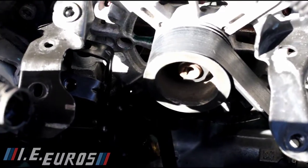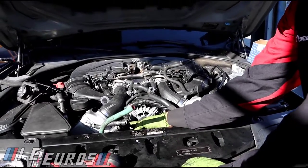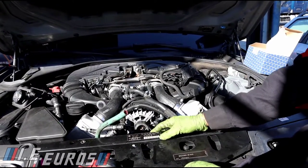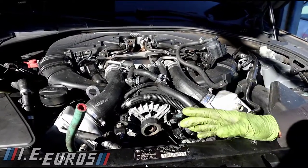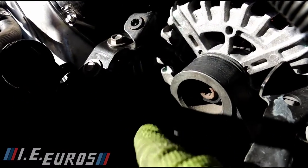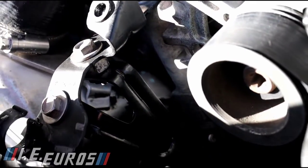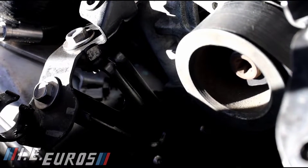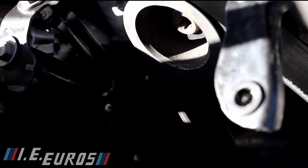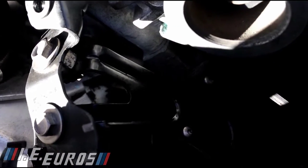Let me get something to get it all tight and once I get that I'll get back to you. Finally the pump is on place. The bolts are there — but you can see I put a spacer right there, under it. I put a little spacer — you can clearly see it right there. That is only to give it enough clearance so we don't pull the hose too much and break it. The hose is short too, so we got enough room to tighten the pump so it doesn't hang around once the engine runs.